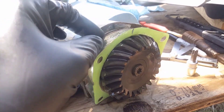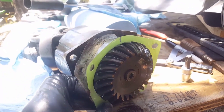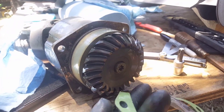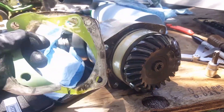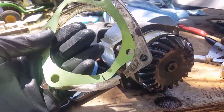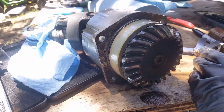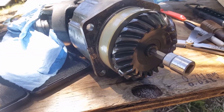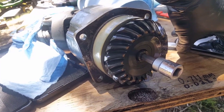As you can see, we've got the bearing carrier assembly on the bench. This inner seal looks like it's definitely busted. The green seal seems like it's still intact. We'll probably have to buy new seals — that may all be one piece, hard to say. It's definitely broken though. I indexed them just in case they go in a certain way — they probably don't, but it is what it is.